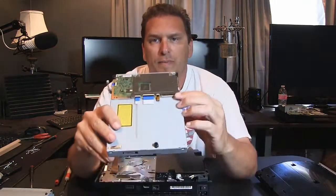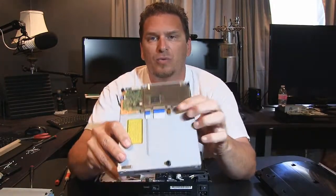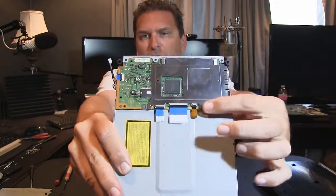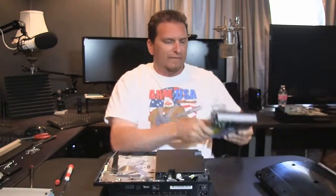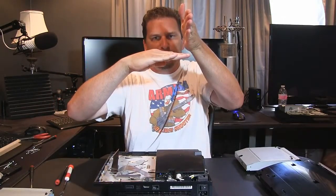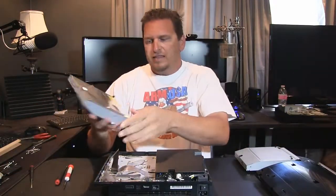Now, these ribbon cables slide into these little holders. You can see this blue one here. You see that blue one? And if you look at the darker brown strip across the top, it's like a little gate. See how it flips up and down right there? It's a little lever. So when you slide that flat cable in like this, the cable just sits in there, this lever basically folds down and squeezes. It applies a little bit of pressure. It's not anything more than that.